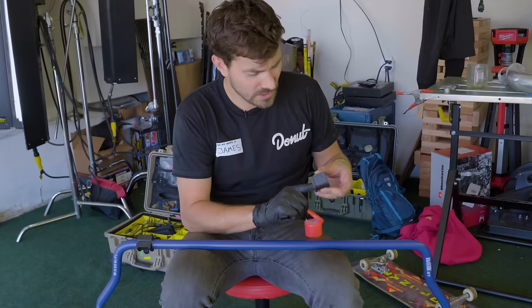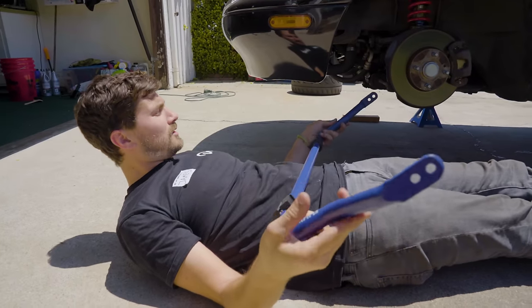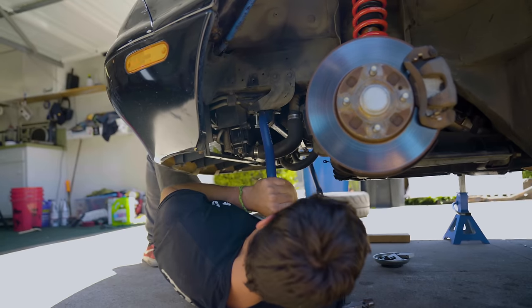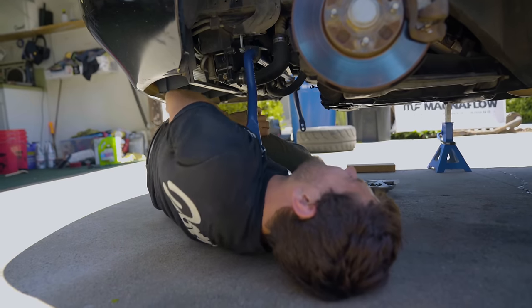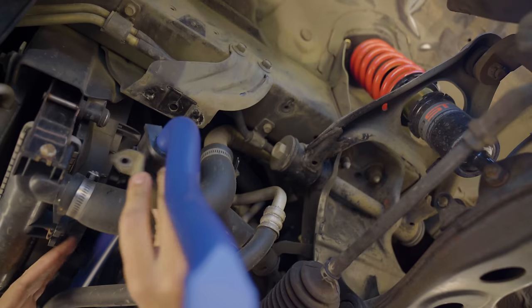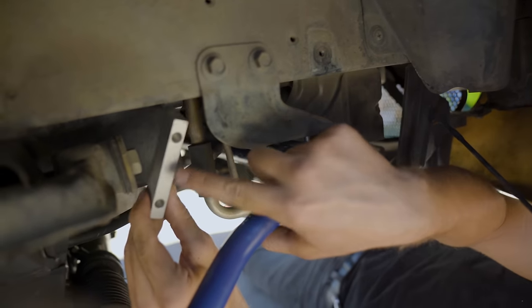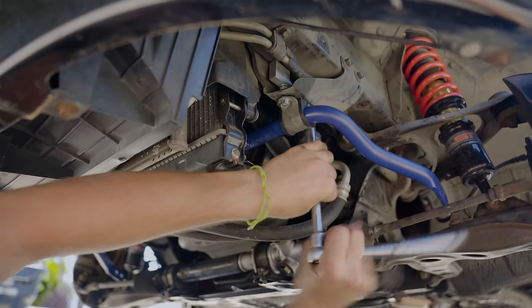Now let's put these beautiful blue bars into the car and see how it feels. First, I'm gonna put some grease inside these bushings — you don't need too much, just get it in there, give it a nice coating, and then back on. The front bar is identical whether it's this way or that way, so the front bar is fine. The rear bar, however, there is an upside down. Once all the hardware is started, we're going to tighten it about halfway and then put our braces in place. This is the brace — basically the ends of the sway bar hardware go into these two little holes, and then it pushes up against the frame horn to solidify the mount a little bit. It's really simple but it should do a good job.